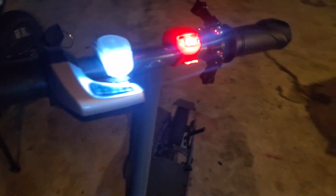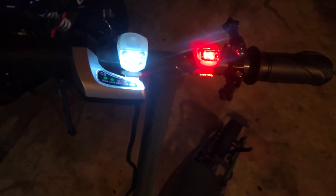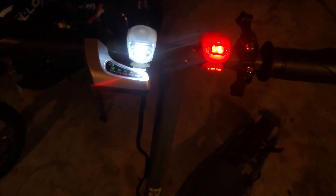The motor is still a 24 volt rated 350 watt motor, but I ordered the 1000 watt controller because I knew it was going to have some extra wattage since the voltage is being doubled. There's a chance that once you start going uphill it could probably reach around 700 watts or so if you really pushed it, so I wanted extra room for power. The motor isn't really the most powerful, but if I put a bigger motor on it, it might drain the battery more, so I'll do that later.